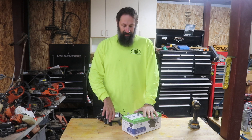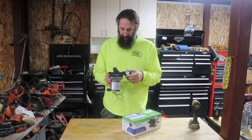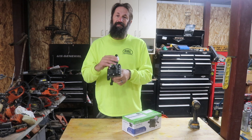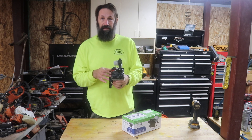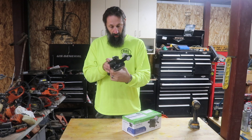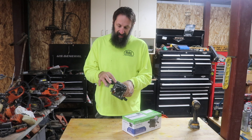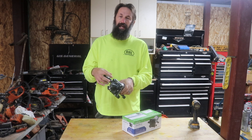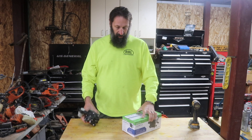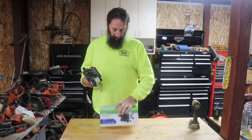It's been a couple of days. As you saw, we got the pump running by knocking that black piece — the little round cylinder that was just jammed, probably from dirt. That's a fix for these pumps if you're out somewhere and can't replace it. The problem I had was two screws broke inside the base of the water pump, and I was unable to tighten it back together. You could drill out the broken screws and put a screw with a nut on the other side, but I just went and bought a new water pump.